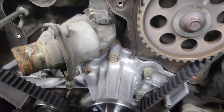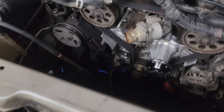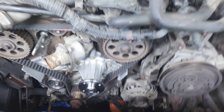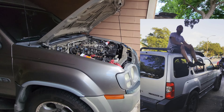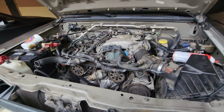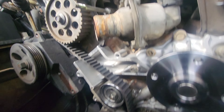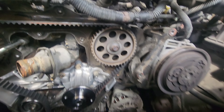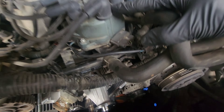I got the new water pump installed and the timing belt set to top dead center. Started it up and it started up great - couldn't leave it running too long because the transmission lines aren't hooked up, so it made a little mess, but so far so good. I actually used to have one of these SUVs as my first traveling mechanic car, so I know my way around it. It's one of the best engines - it's not meant for speed, it's just a little billy goat. Got the water pump installed, all bolts torqued down, and I rotated the crank by hand about four times just to make sure the timing marks lined up, along with the distributor at number one.